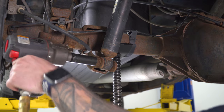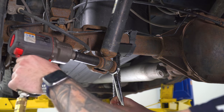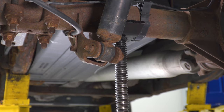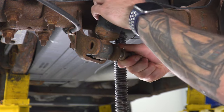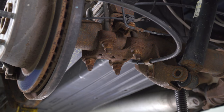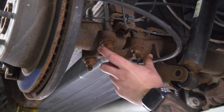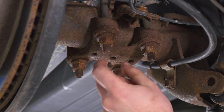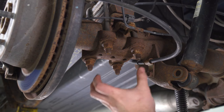It's very crucial that you have the weight supported underneath. Using your 21 deep socket, we're gonna start removing the bolts on the U-bolts underneath where the cradle is. I'd recommend loosening them all the way to where they're just hand tight and you can pop them off by hand, because this cradle is gonna start to drop. I like to leave the nuts on a couple of threads so we can easily catch it. Just work your way around all four, and once you get to the last one, the cradle is gonna come with it — so pull that off with it.